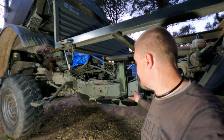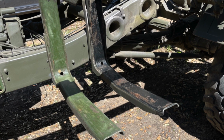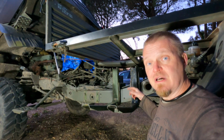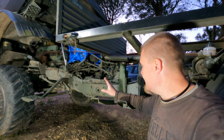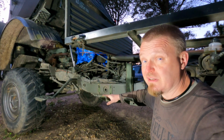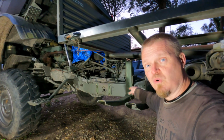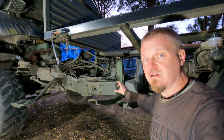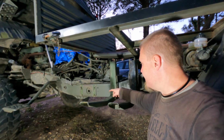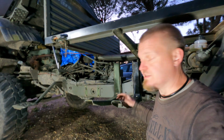Yesterday there was nothing here, now there's the brackets. The rear bracket, as I said, is a straight swap from there. Just the bolts have to come with the brackets, and then the nuts and bolt has to go to the other side. This bracket is also a pretty straight fit with a bit of a caveat. The existing holes that were there are the right distance height-wise, i.e. vertically, but they are 95 millimeters too close compared to the other side.